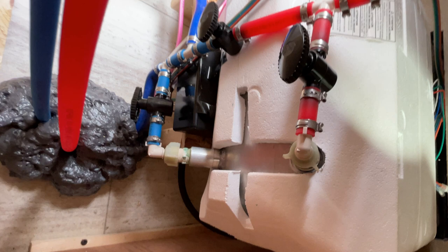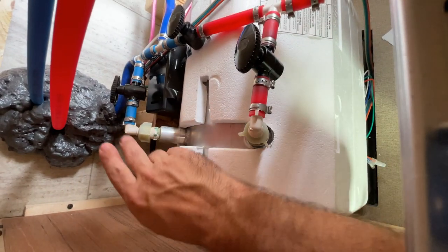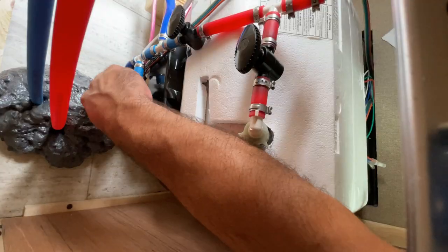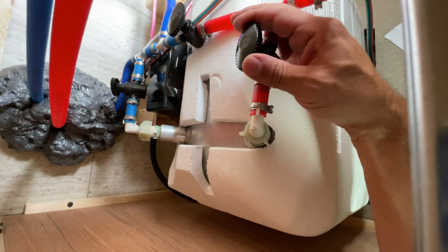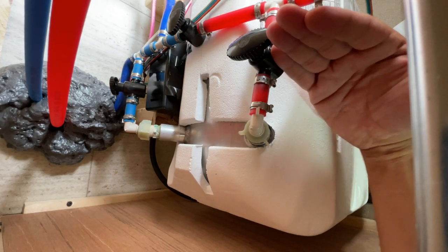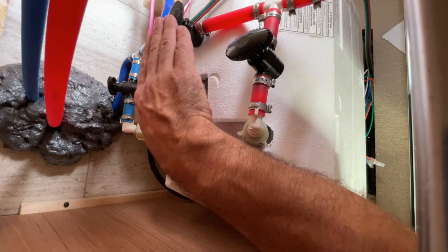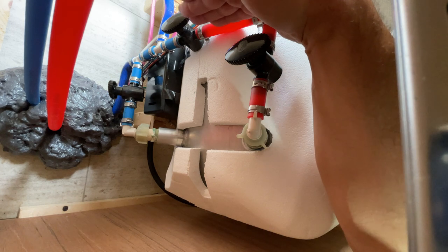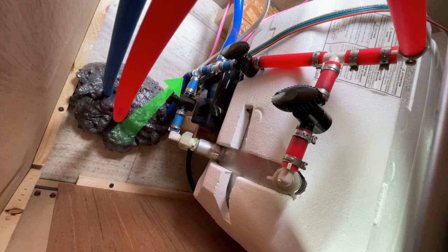Some manufacturers are going over to a two-valve system. My RV has a three-valve system at the bypass at the water heater. Under normal operation, you have cold water coming through this line going into the water heater, it gets heated up, and then comes out this line and goes to your hot faucets. You're going to want to close the cold line going into your water heater and also close the hot line coming out. When these are closed, the valves will be perpendicular to the line that they're on. Then open the bypass valve — it should be parallel with the line that it's on — so the solution flows through the cold line, up through the bypass line, and back out to the hot water faucets, avoiding any contact with the water heater.